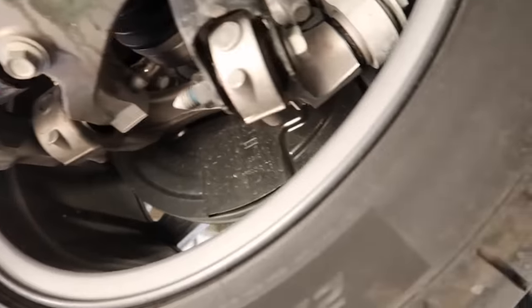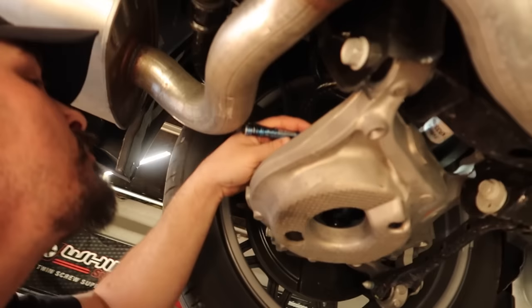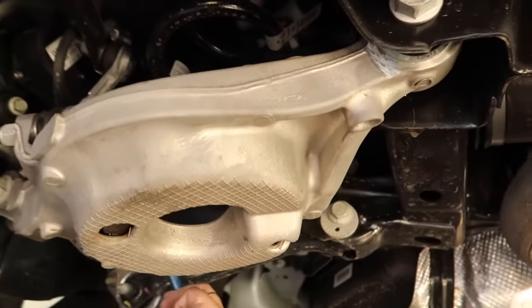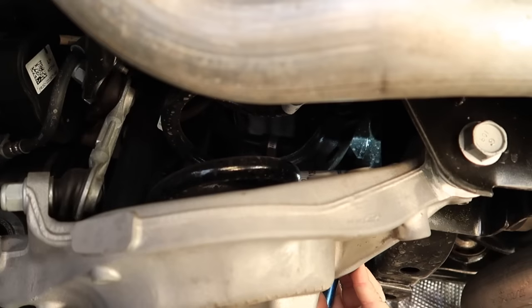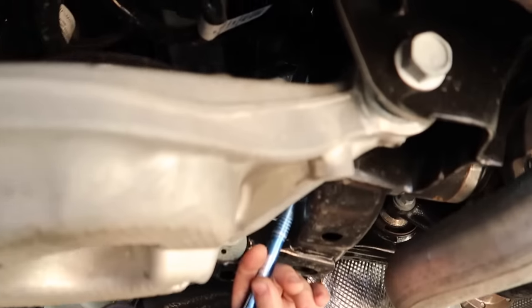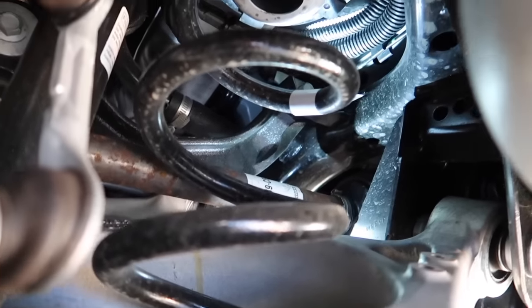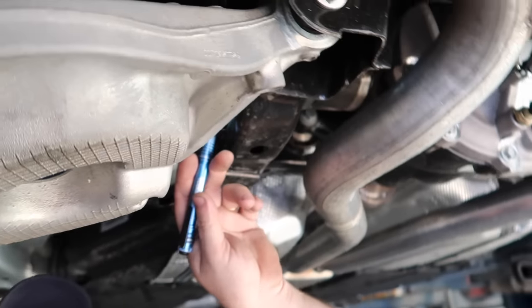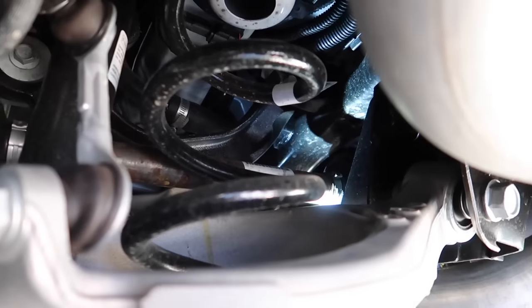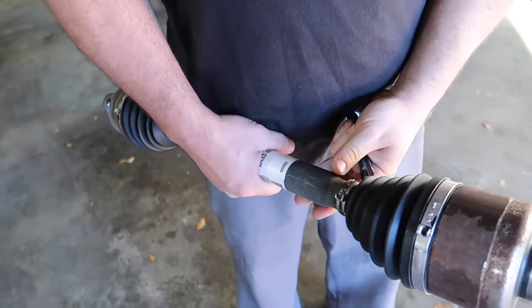So we've got a stock axle here — trying to see if they're any different. We were hoping for GT350 axles. Some of the manual cars got a different axle back in the day, and the Dark Horse is definitely going to have that since the Mach 1 had it. Looking at the part number — it's a BA suffix — it does look like a different part number similar to the other manuals where they did the GT350 axle upgrade. This side has the hollow in it, and notice how the passenger side doesn't jump up — that's a regular passenger axle, but the driver's side is different.